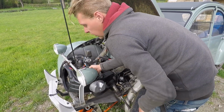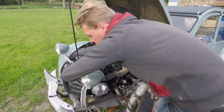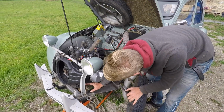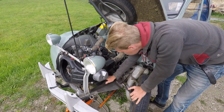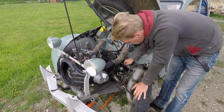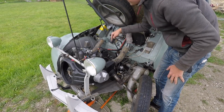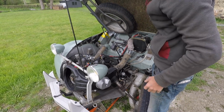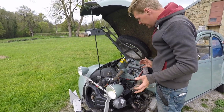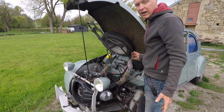So the exhaust on Jolene passes out the front of the exhaust manifold, so it goes forwards, then it goes round the front of the engine. The centre section of the exhaust fits underneath the engine here, and then goes back, and the rear section of the exhaust fits underneath the gearbox, and fits to 2 bolts on the gearbox. So it's pretty tight in there, which is why taking the whole front of the car off helps.